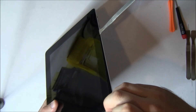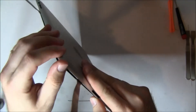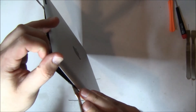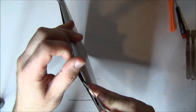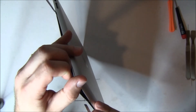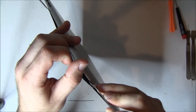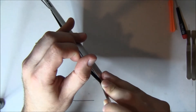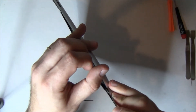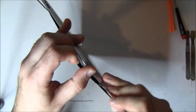What we're going to do is actually lift the iPad up, and by lifting it up, we can use our fingers to pry it apart a little bit and see where that antenna is. As you do this, make sure you don't bump the power button — you do not want to turn the power on. So he can see the antenna and he's going between the glass and the antenna to separate it. The antenna is a very thin, flexible piece of plastic — it tears really easily, and once you get a tear in it, the Wi-Fi and Bluetooth no longer work.